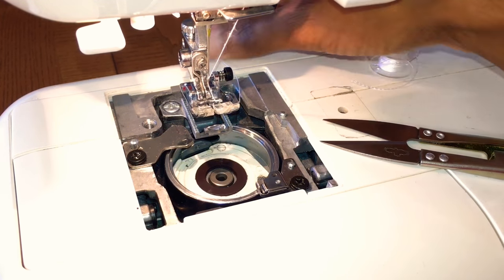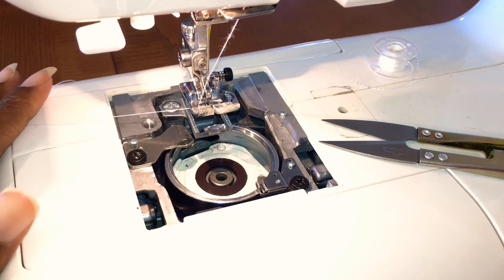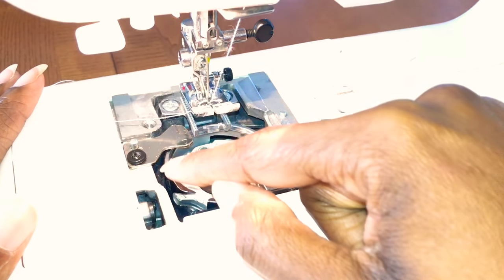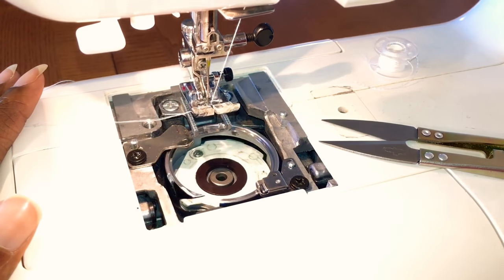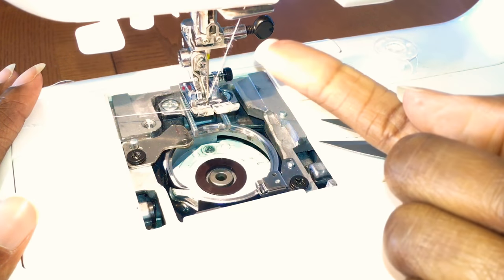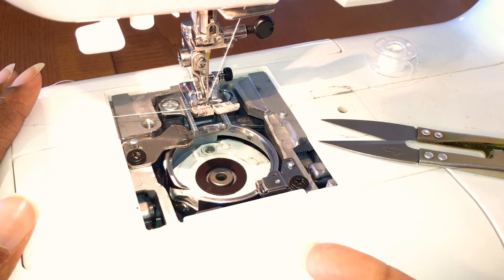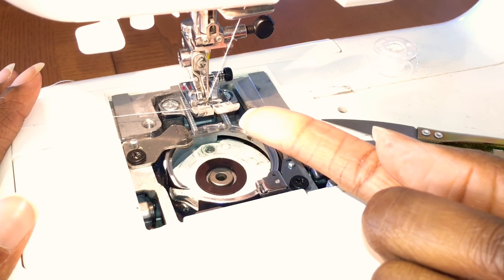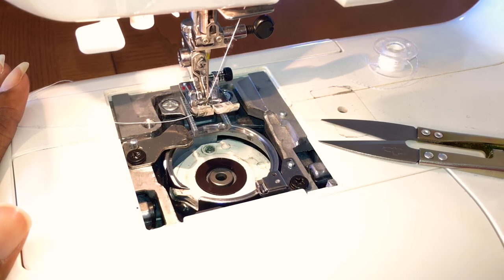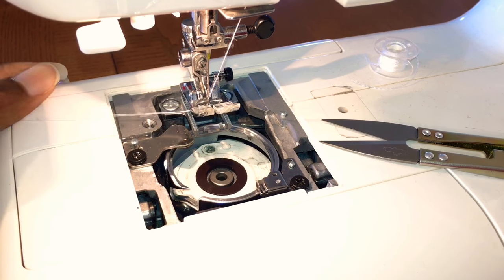If you've seen my first video, I pretty much stripped this sewing machine and put it back together. So what we have here — as you can see as I'm turning the hand wheel — this shuttle is going around. This little hook right here is what is going to grab the thread from the eye of the needle. What needs to happen is that this hook and the eye of the needle need to cross paths at exactly the right time — that's what we're talking about when we say the timing of the machine.